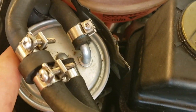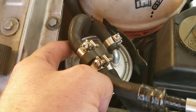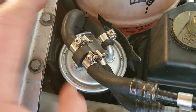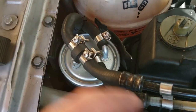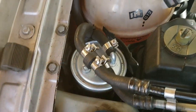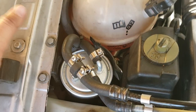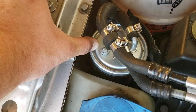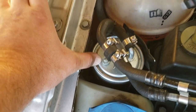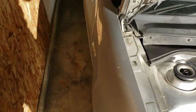Look at this — all dry. I even switched my fuel filter to the old school filter, where it didn't have that middle part with the notorious leaking seals and the recirculating diesel portion. I switched to the old one and ran the straight line back, did this modification because I thought this was where it was pulling air from, but that was not the case.